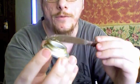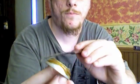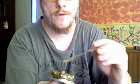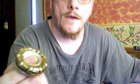Alright, and the next step, which helps, is to grease up the drive side race. Put a little grease on it to help the bearings stay in place, which helps installation because they will move around a lot if they're not greased up. Make sure you got enough grease on there, because a well-greased bottom bracket is going to spin real nice. Yet again, you put the bearings with the back side onto the race and squish it down. They will get a little hairy and dirty if you're using a rag. It does not really matter that much. And then put just a light bit of grease over the outside of the bearings, like so.